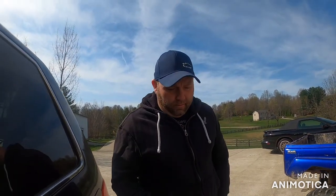They cut one in the green Trans Am I had too. This is my actual personal car - I wouldn't do this to a customer car, but this is my car. I don't plan to ever sell it, and if I do they will know it has an access panel. This will cut off a lot of aggravation, broken bolts, and time. You do need to be careful though because your fuel tank is right there. I'll use the Sawzall, and hopefully you don't have any leaks because you could cut your fuel lines in half - sparks plus fuel equals boom, that's not good.